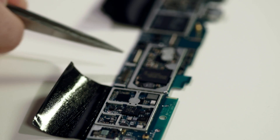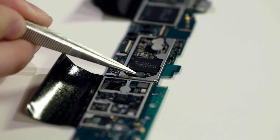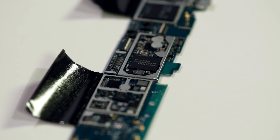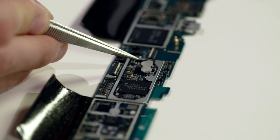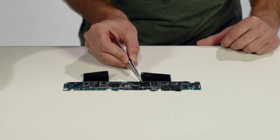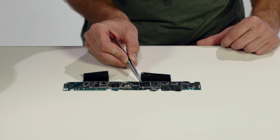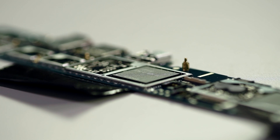The larger piece on the motherboard is the memory, which varies from 16 to 32 gigs. To the right of it is the light management unit or LMU, which controls the backlighting of the tablet's display. Here we have a power management component with heat conductor goo — yep, that's a real term. Moving on to the processor and RAM, which both sit on what engineers call a PoP, package on package. This enables the thin design but also enables quicker access to the RAM memory via two layers of components. The top piece is the 3 gigabytes of RAM and on the bottom we have an 801 Snapdragon 2.3 gigahertz quad core processor.